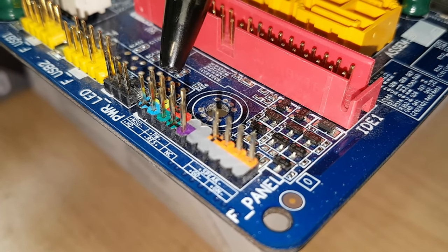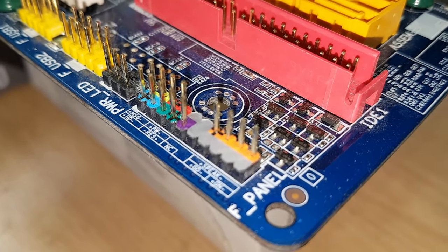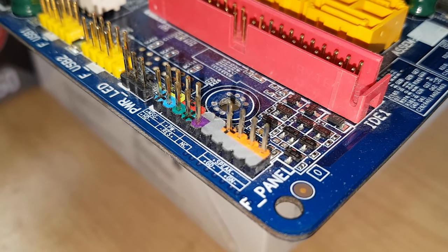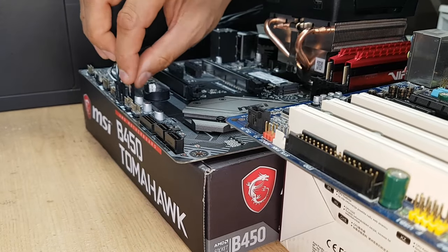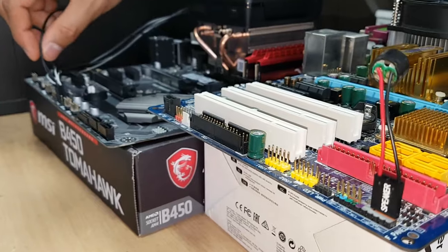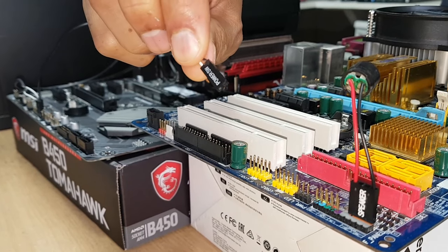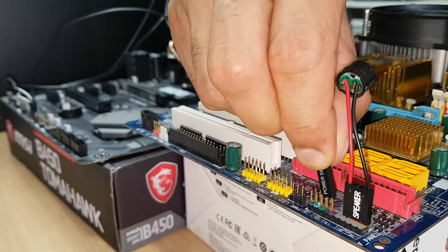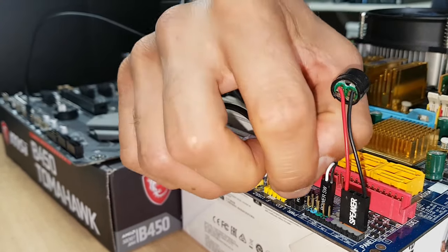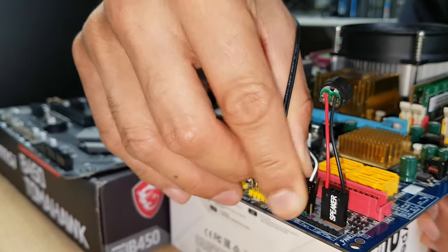On this older model I didn't bother with the power LED or MSG because I just needed the computer to turn on — the speaker was what mattered. Hopefully you can figure it out from the manual; if not, let me know in the comments. Now let me show you how to connect them on this Intel board. We'll start with the speaker cable for reference, then grab the power switch — always pull from the end of the connector, not the cable itself, as over time you might break them. Power switch: done. Power LED goes here, HD LED goes down here, and the reset switch goes here last.